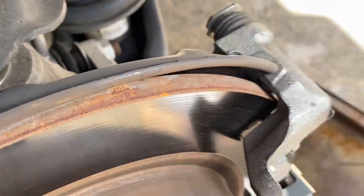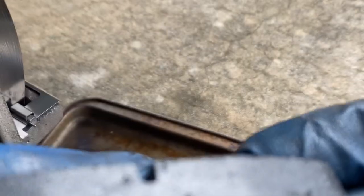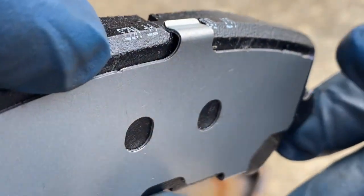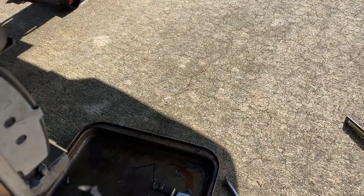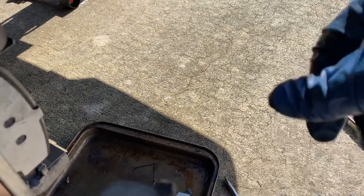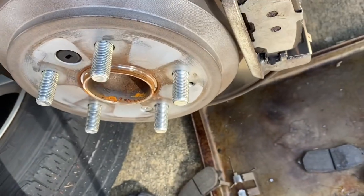These slide pins are free, so I don't need to re-grease them — very important. Got to stick the brakes on. These have a special clip here — they go in these places. It makes this job a lot more difficult because it's a spring that pushes out the pads, same thing as on the front. I might put a little lube here and then smear the back of the pad. But make sure you put the wear indicator on the right spot — always compare it to the old pad to make sure. The wear indicators go on the bottom, and then you slide them in.